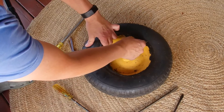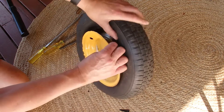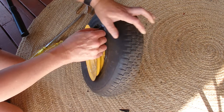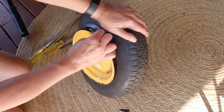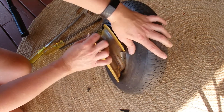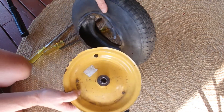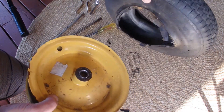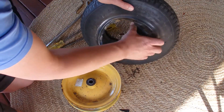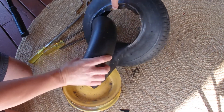Now with one half of the tire off the rim, it's just a matter of pushing with a fair bit of force — pushing that tire forward and pulling the rim towards you — and the tire quite easily comes off the rim. There's the rim, and the inner tube is still inside. Then you can just remove the inner tube from the tire and start to replace it with the new inner tube.